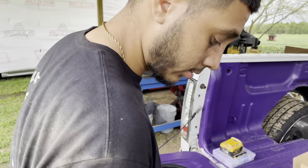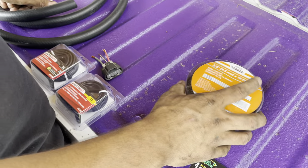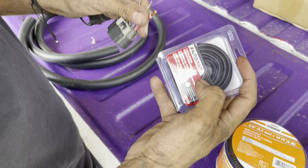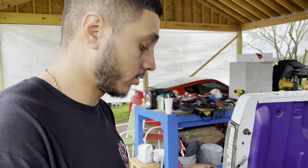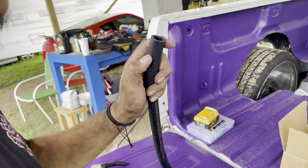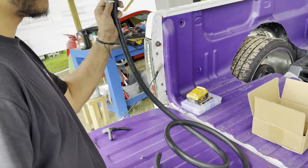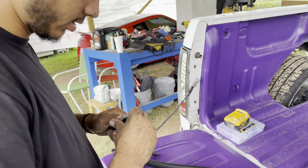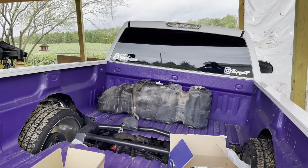Take two — we went to AutoZone. We had to grab some more clamps, the 5/16 to 7/8, some wire loom just to make everything look good, and then some 12 gauge wire for the thicker wires — that's all they had — and 14 gauge for the smaller wires. All they had in stock was 5/8 heater hose, but you'd want to order the braided line. Cause if you grab the heater hose, the gas is just gonna eat the inside up. So this is just temporary until the braided line comes in.